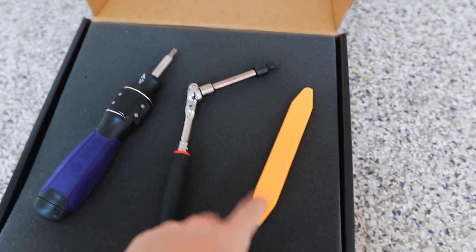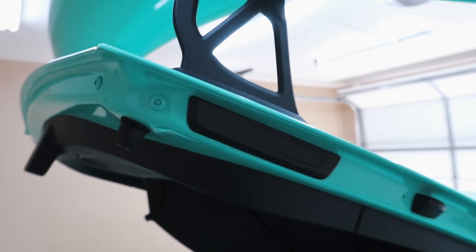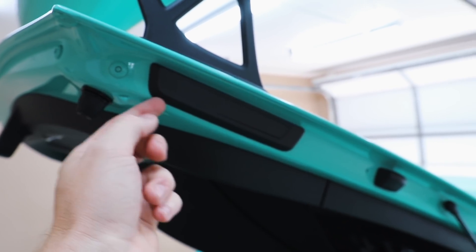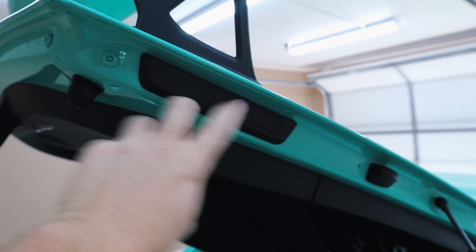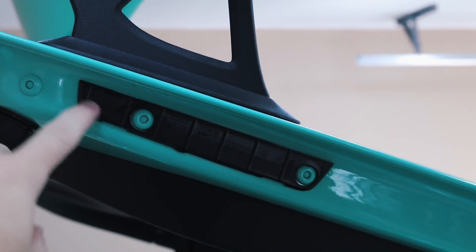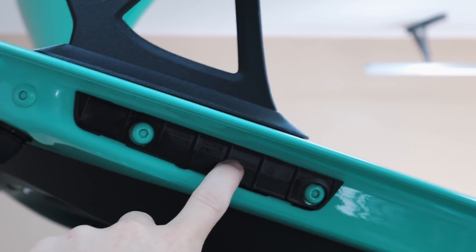There are just one or two plastic pieces you'll use to pry off the covers to get to the bolts on the wing supports. Other than that it's just going to be a heat gun and some manual labor. First step: pop the hatch open and pull the covers off — there's one on each side. Use the plastic pry tool to loosen the clips. There's a plastic piece underneath that it's adhered to, so we remove that. Then get the heat gun out and heat this up to loosen the adhesive — there should be a couple bolts under here.